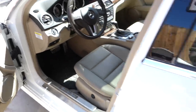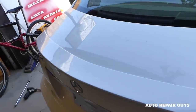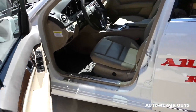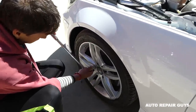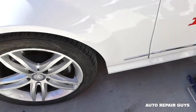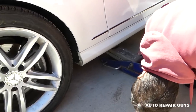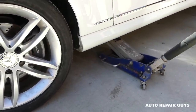Don't forget to apply the emergency brake. Next, get your tire chocks - since we'll be working on the front left, place them on the rear right. Usually you do a diagonal placement; the more tire chocks you install the better, to be safe. The car has to be in park. Take the lug bolts loose, then get a jack and a jack stand - I always use a jack stand, not just a jack. We'll have all the tools used linked in the description below.